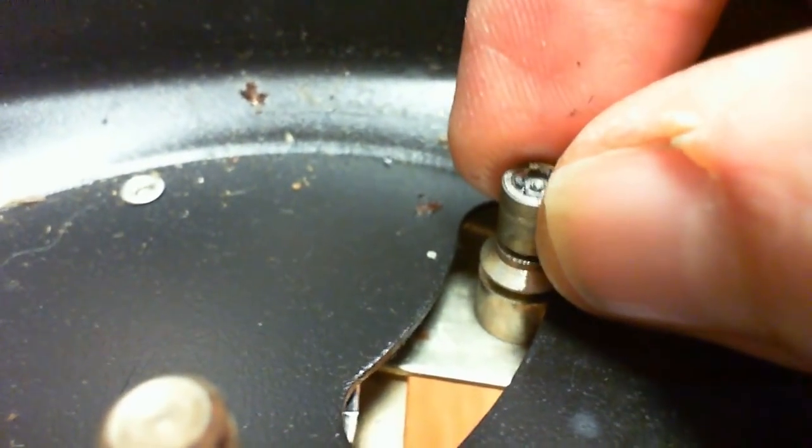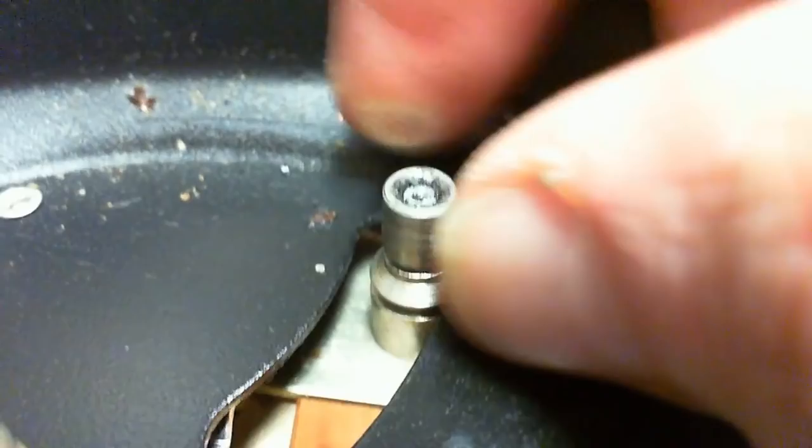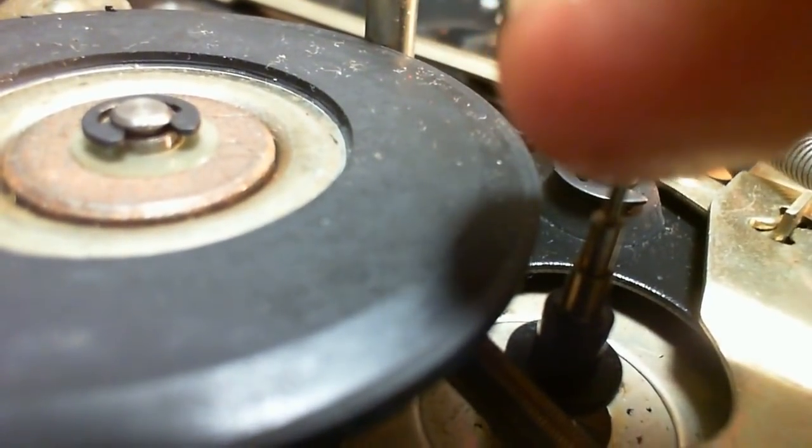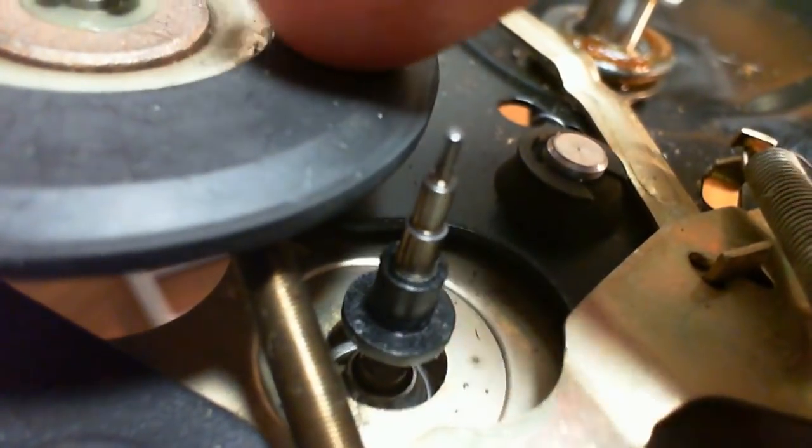If this roller is stuck, it won't necessarily stop the record player from operating. It just results in more work for the motor to move all the mechanism. If you give the motor too much work, the most likely thing that will happen is slippage in the traction system — all the way from the spindle to the wheel to the outside of the record player rim. If you ask the record player to lift a ton, all you'll get is skidding on these parts. That can make you think the problem is failure of traction strength, when in fact it's just not enough lubrication in the mechanism.